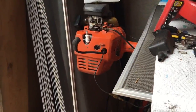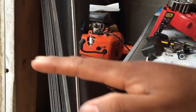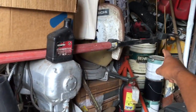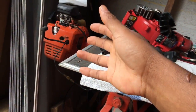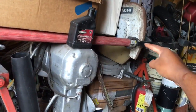Now we know it works. Maybe it just needs a head gasket in between the top of the head and the bottom of the crankcase. It also did not spin the saw blade — it wasn't rotating. I don't know yet what the full problem is, but I assume once I get the compression fixed and put in the gasket, it will have the power to move that blade.